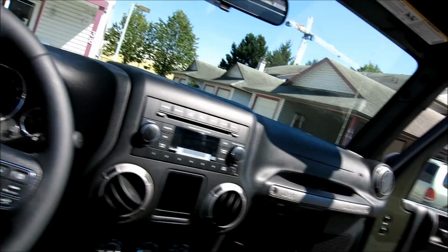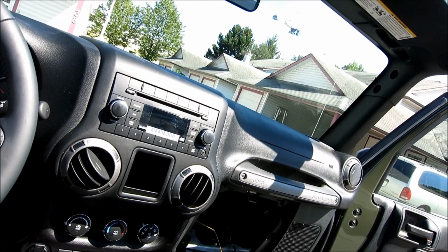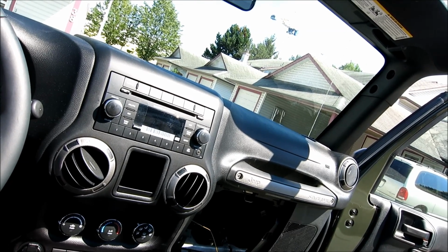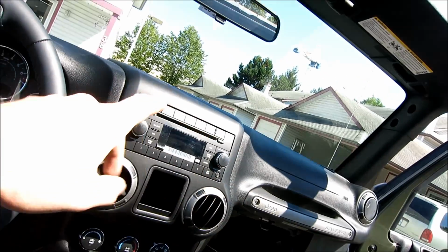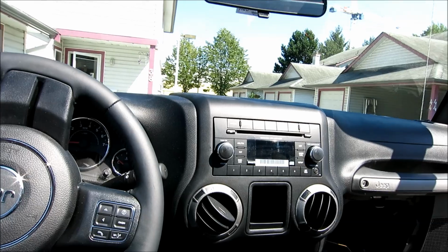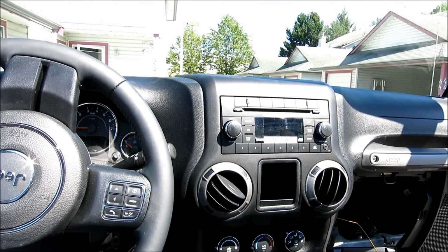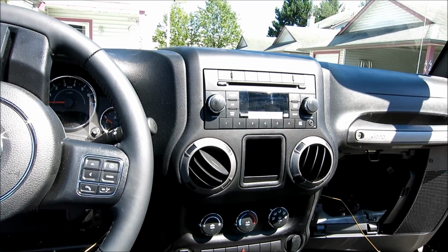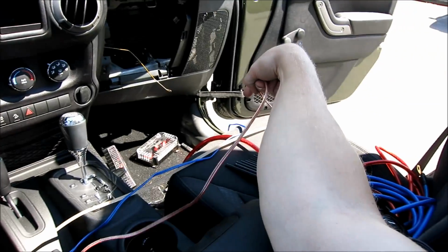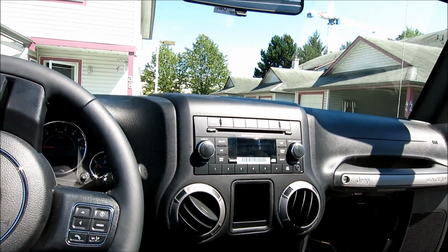into here. Now, if you have an aftermarket stereo, it's different. For the aftermarket stereo, you just have to worry about the RCAs, and that's not a big deal. All you'll do is you'll run all your new wires to the amplifier and then run the RCAs from the aftermarket deck to there. If you're wondering all about that, you can always look up Go See Rich 4-channel amp install, and I've done so many of them with RCAs for running from an aftermarket deck to them. Like I said, since we're using a line output converter, I have to run a bunch of lines to the line output converter. That's kind of how it goes.